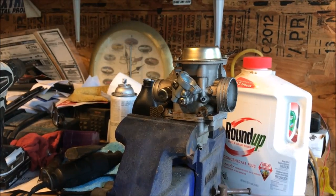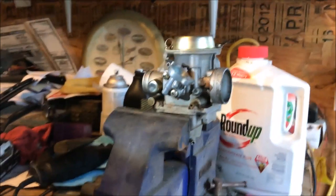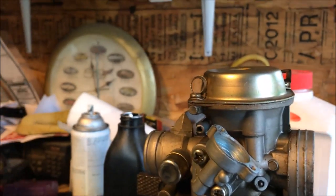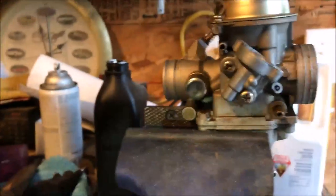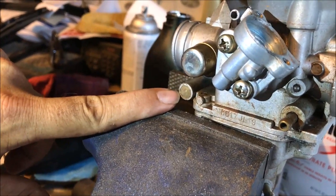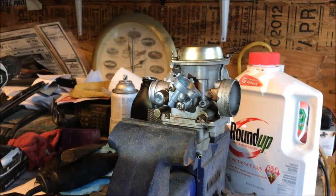We don't like that — just like we cut the screws off the bottom of the bowl when they took the screw heads off, we're going to defeat them on this little gadget too. You can see the part of the carburetor that goes into the intake, and this is where the air cleaner tube goes on. This little guy right here, where my fingers are, is the block-off plate they put in to prevent you from getting to the mixture screw. The EPA likes everything lean, and sometimes the buggies don't like running lean.